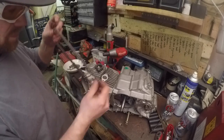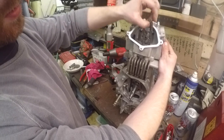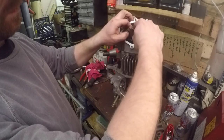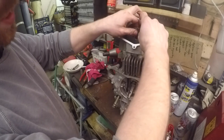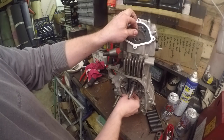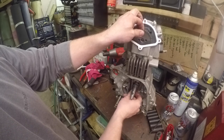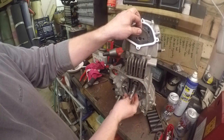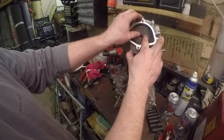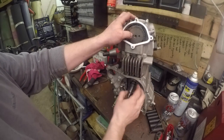Using that trick I found top dead center — and if you look at the engine you'll notice that the woodruff key for the flywheel is pointing that way, which is another indication as well, but I like to double check. Next thing you need is your cam chain. Lower the cam chain down, get your cam gear, thread it through the chain, then lift it up so the cam gear with the chain on it is pointing directly upwards. That engages with the bottom gear — the little dash is pointing straight up, the chain is around both gears. Happy days.